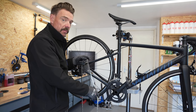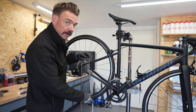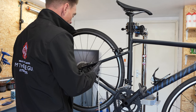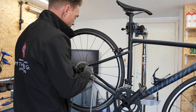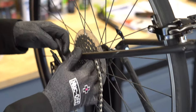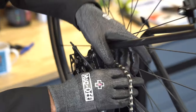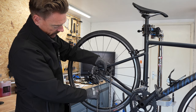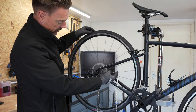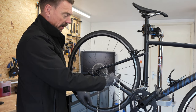This next part is quite fiddly, so let's get on with it. I'm starting by threading the chain over and through on top gear at the back — the smallest sprocket. For now I'm just going to let it dangle over the top jockey wheel. Stick half the chain down past that jockey wheel for now, and then go and do the front end — dangle that down there, reach in and get hold of it, drop it onto the small chain ring, and just pedal gently. Perfect, that's a good start.